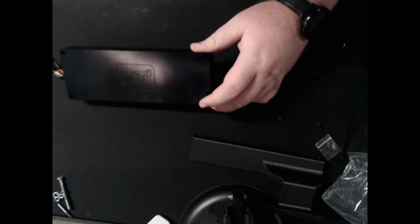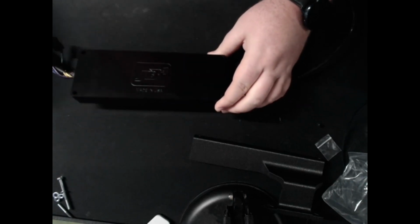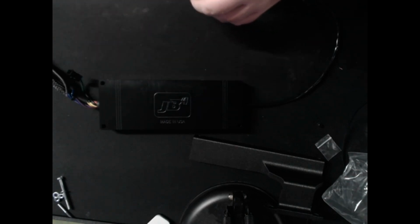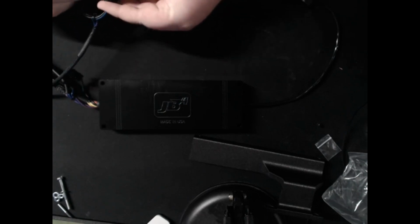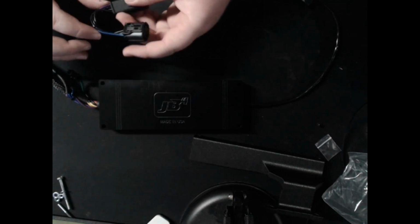This, I don't think I explained it earlier. It's more of a piggyback unit. These sensors sandwich in between the stock sensors. Then the signal goes through the OBD to the ECU, and that's where you'll get your other readings, from the OBD. So this basically kind of hijacks the signals, feeds sensors signals while telling the ECU everything is within stock parameters. This is not a flash.